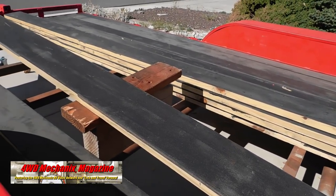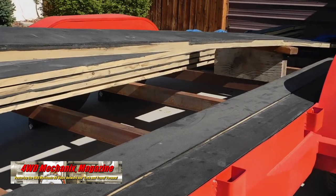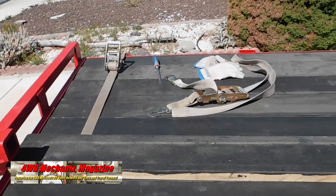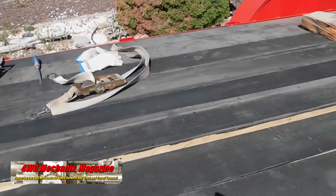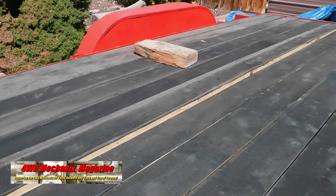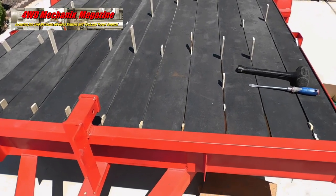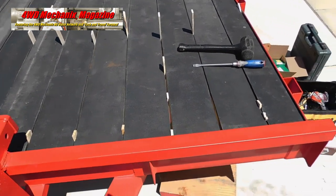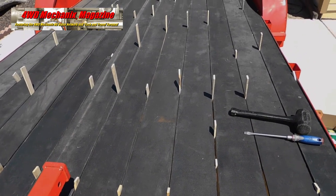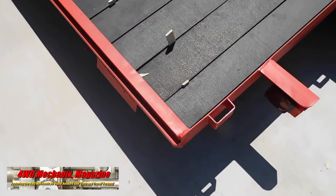When sized properly, each plank needs to be bent over a stack of wood. The planks have been ordered cut to length. Use just the right amount of bend to fit the plank below the short lip at the end of the trailer. Heavy-duty ratchet straps make short work of pulling the planks together and to one side. Fitted properly, each plank fits to within 3/16ths of an inch gap at the end slots. I use the lengths of the original planks as a guide for ordering the new planks from Blackwood Lumber — that's the safest bet when determining the correct length.